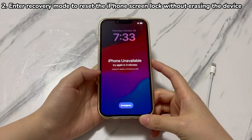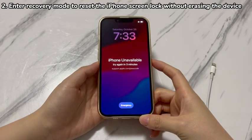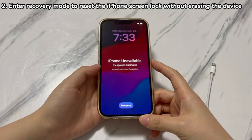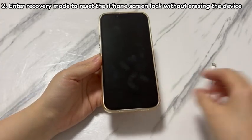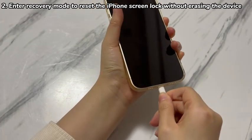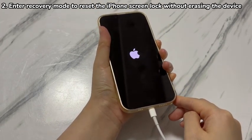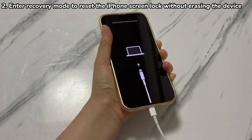Get a PC or Mac — if you don't have one, you can borrow one from your family or friends. Download, install, and open the Apple Devices app, iTunes, or Finder. Then shut down your iPhone X using the volume down button and power button. Get a USB cable and connect one side of the cable to the computer. Next, hold the power button on iPhone X while connecting the other side of the cable to the device until you see the recovery mode screen. It should appear as a cable pointing to a laptop with a black screen background.